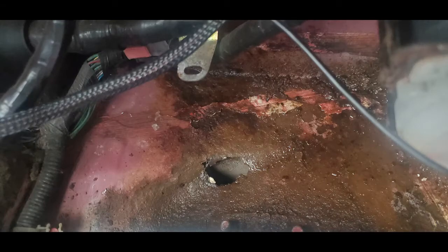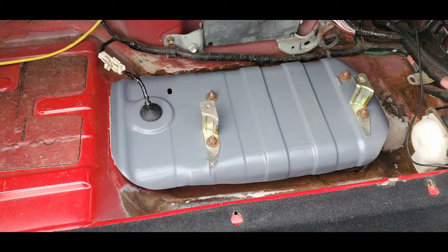Sure enough, there is a leak where water has been accumulating and has rusted away a hole into the body. The leak came from a small rip in the funnel that gathers water from the soft top edge, and I sealed it up with a small amount of gasket maker I had. After a heavy rainfall, I couldn't find a drop of water anywhere. The evap shield was also rusty on the edges, so I removed it, sanded it, and primed it.